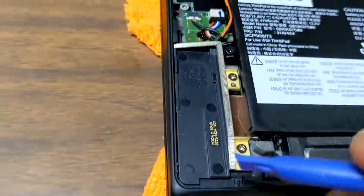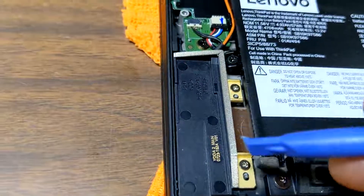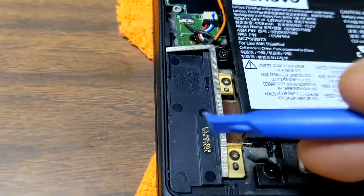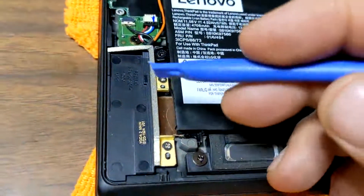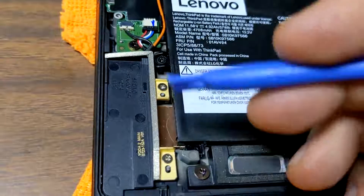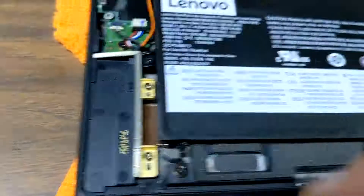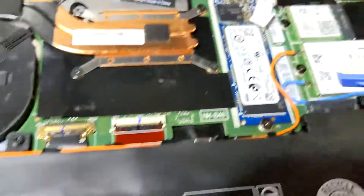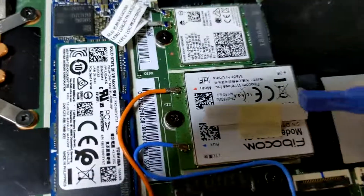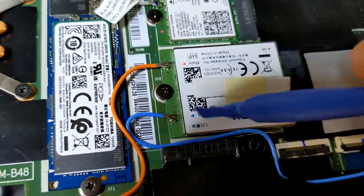On the other side in the front, you've got the main side of the antenna. There will be some plastic spacers in both sides of the laptop — just take those spacers out and these will go in place of them. The orange on the main wraps around and goes over to where the WAN module is. You'll see where it's actually labeled for the main — it's color-coded as well — and the auxiliary.